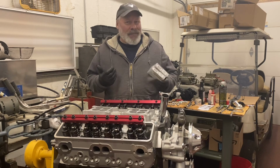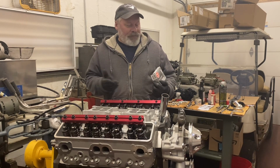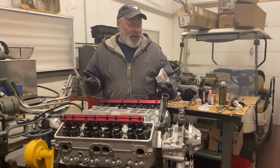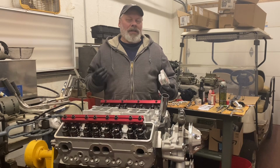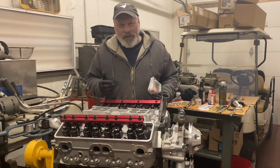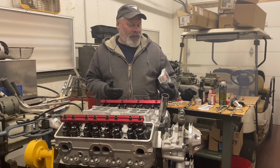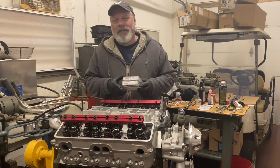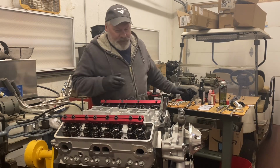Nowadays, if you're lucky, you get them for $5 or $6 a piece. That's the world we live in. But they go by 2 different numbers. NGK does a BKR7E, so it's a resistor plug, heat range number 7. Good place to start. They also go by 4644. These are 4-packs. So before I screw those in, I will check compression, like I mentioned.